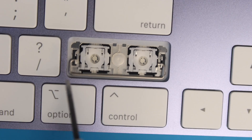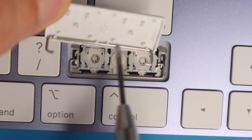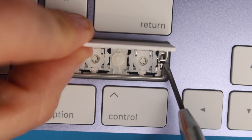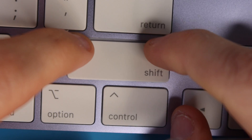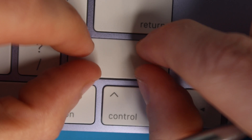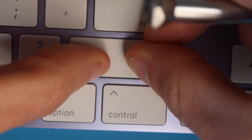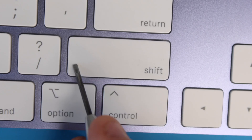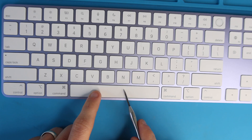For reinstallation, float the bottom bar in and push it down as far as it can hook in. Then take the key cap, attach the top support bar, drop it into the channel, and roll the key over. Press down on the top of the key while pulling it towards you a little bit, then push the key all the way forward to lock those awning clips into place. Then put pressure on the bottom of the key to clip the lobster clips and the bottom support bar.